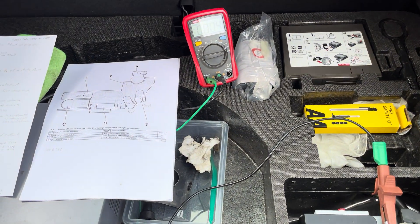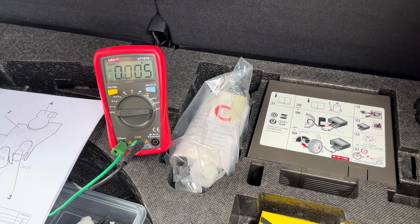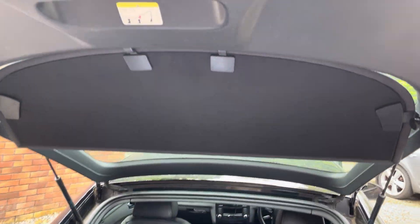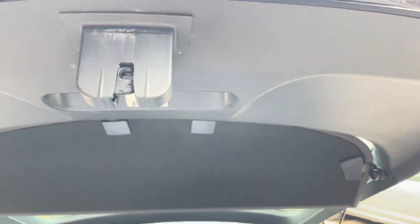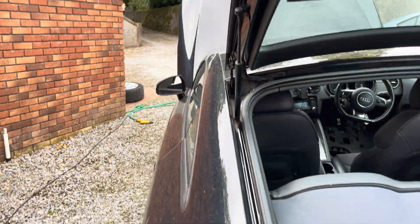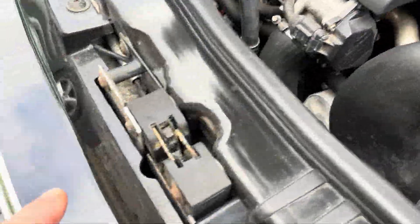At the end of the journey now — I found the fault, which I'll explain in a minute. You can see the quiescent current draw from a 12 volt source is about 4 to 5 milliamps, occasionally going up to 6. That's with all doors closed and I've pushed the boot latch up with a screwdriver so it thinks the boot is closed, otherwise the light comes on and pulls current.